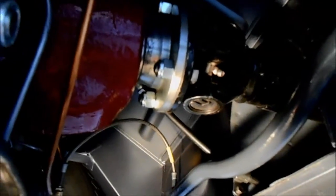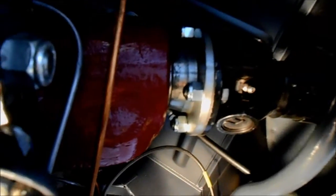While I was in here inspecting, one of the surprises I came across was while putting the emergency brake cable on — I looked up and saw that there were only two bolts through the pinion flange into the drive shaft out of four. So I was able to put those in, which was a good find, a good catch. I was happy about that.